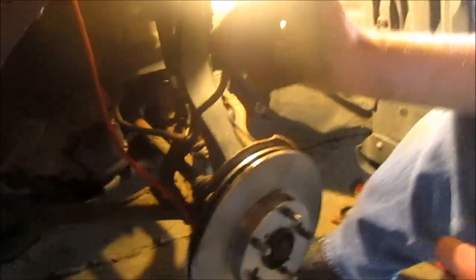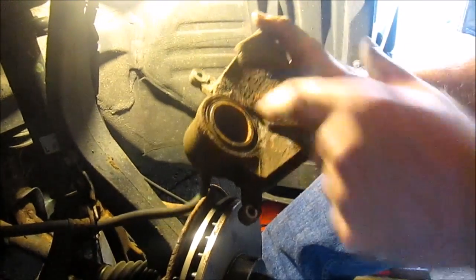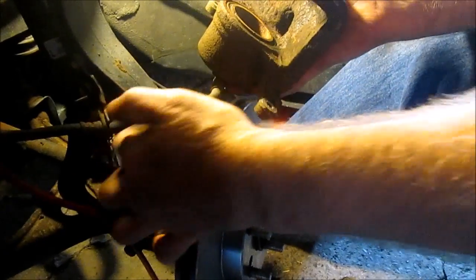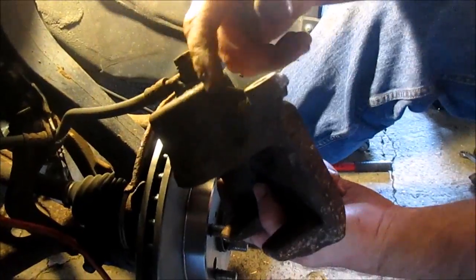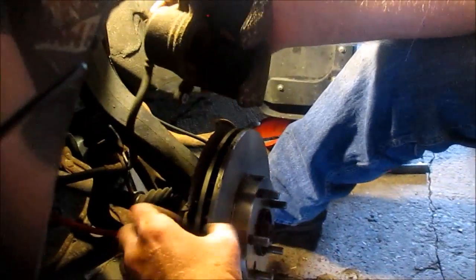And I'll summarize a couple things for those of you who don't know anything about brakes. Focus on this equipment here. This thing I'm holding in my right hand is the caliper. It's a little cup made out of steel that sits inside. This is the hose that has high pressure hydraulic fluid going through it. You put your foot on the brake, it squeezes fluid behind here. It comes out at, whatever, 100 pounds per square inch, and magnify that by the size. It probably puts 10,000 pounds of pressure on this cup. The cup pushes out, it squeezes the brake like this. Now you need something between this and the brake. That's what you have the brake pads for.